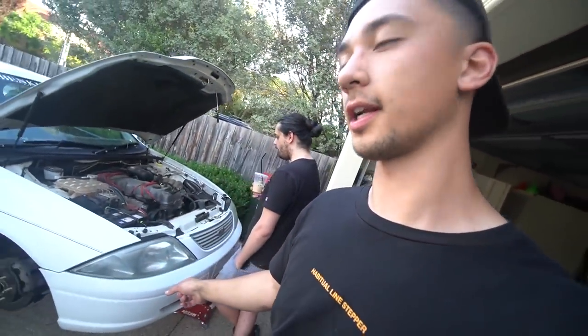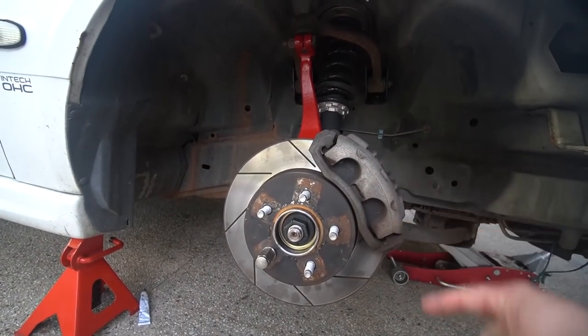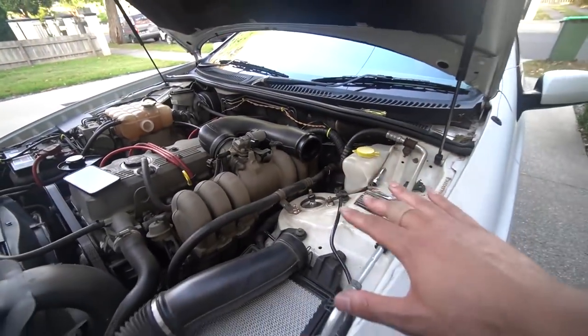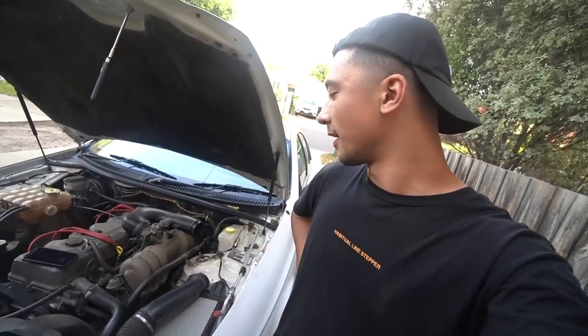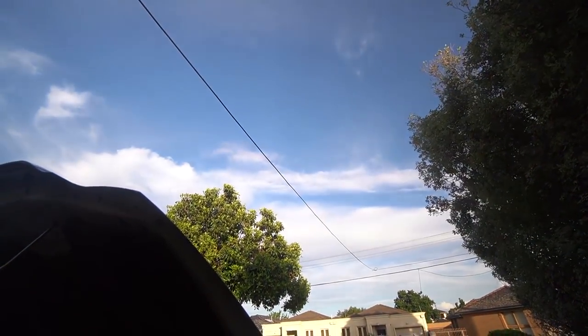As you saw in the time lapse, we got everything all sorted. Brakes and calipers are on, we've got the new wheel bearings on, the new hub on. The arm is on and we've got the camber arms installed ready to go. On the other side we've got the camber arms lightly installed - bolts haven't been entirely tightened down yet. Two Mexican Hoon Cartel camber arms in there - that should give us around negative four to five degrees camber because I did opt for the shims. Without shims you'd get negative six degrees, which I think is a bit much. Nick told me with shims he got negative five degrees, which is plenty. It's much nicer outside now - sky is blue, nice breeze, not hot and windy anymore.